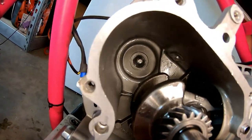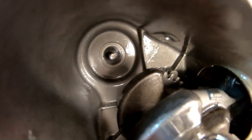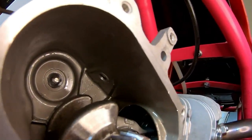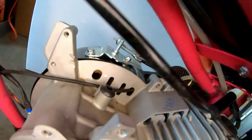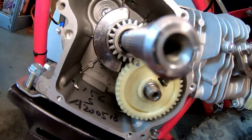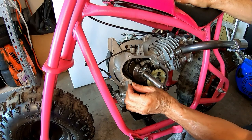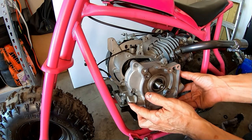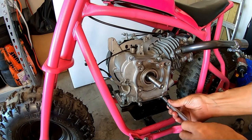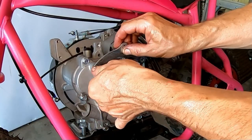You can see down in there - the gear is gone, the little arm is gone. And you can see my bolt sticking through there that I threaded through there, which doesn't interfere with anything. And then the button bolt's up on top. All the timing marks are still in alignment - sweet. Put the little dowel pin in here. Tighten it all back down. Pop this piece back on here for the chain guard.